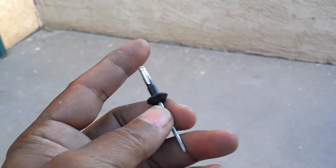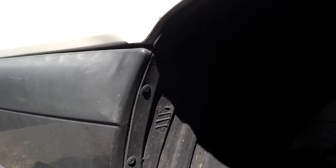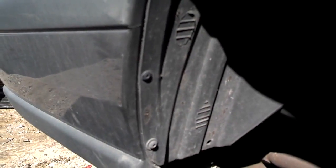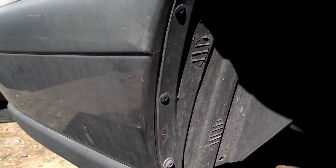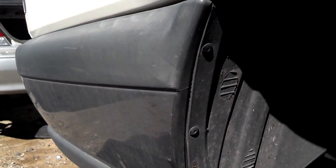Anytime you order something, you may want to order 10 of these just to have them around — they're a lot cheaper from online suppliers than from the dealer. First thing you do on both sides is take loose these rivets. These Volvos have plastic-coated rivets — you've got two here, then you've got a T25. I didn't take the wheel off; I backed the car up on ramps so I could get under it easily. Take those three things loose on either side. I cut these loose with wire cutters — snip them off however you want. They are aluminum rivets coated with plastic.